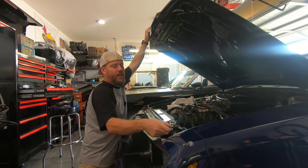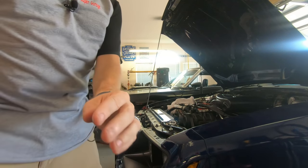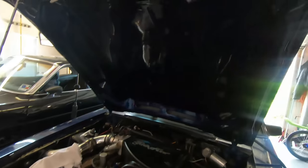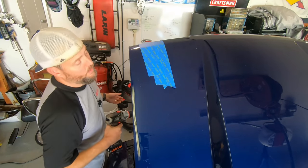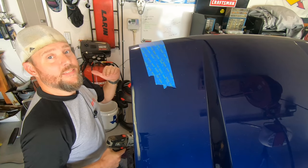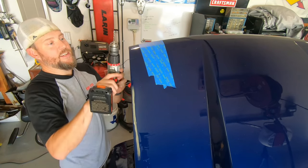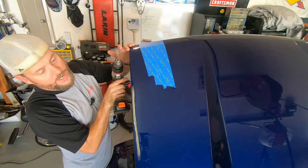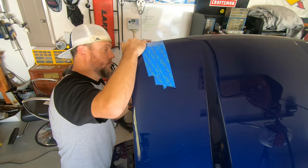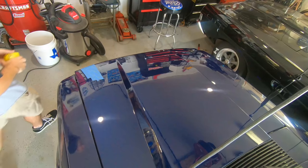Releasing the hood latch so it falls right down — it's sitting right on it, nice and solid. Lifting it up, the mark is almost dead center, maybe just a little toward the top of the hood, which is exactly the same as the other side. The core support is nice and straight. There is our mark — and that is where we drill. Remember it's a little adjustable, but there's no going back once there's a hole in your hood. Be cognizant of keeping the drill bit level with the angle the hood is open.